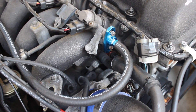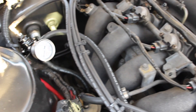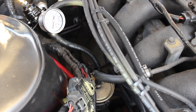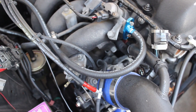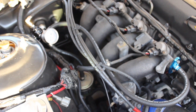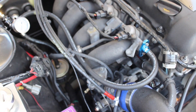There it is, all completed. I had to grab some hose clamps, but here it is — the fuel rail adapter connected to the inlet port on the fuel pressure regulator. And this one right here goes down to the tank. It's done — I'm gonna have to clean this up, there's a lot going on, but it should be working.